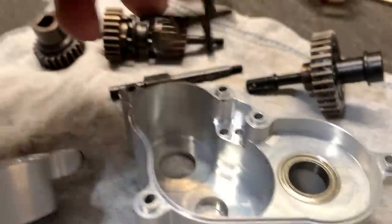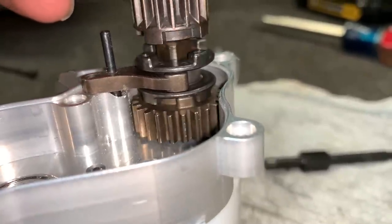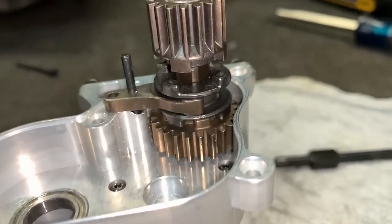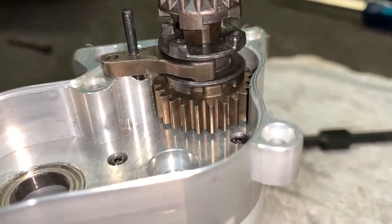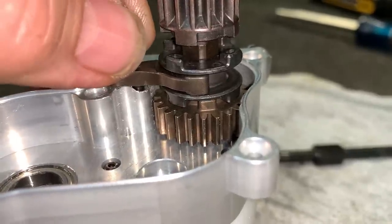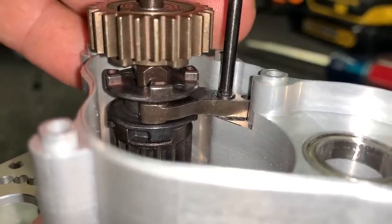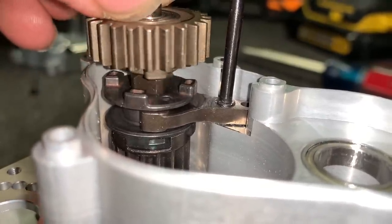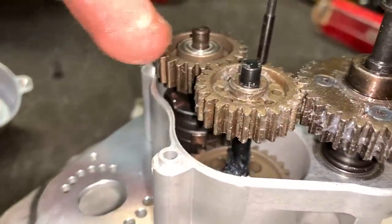This way I can get full lock to both sides. I want you guys to see right here: I have full engagement of second gear — full engagement — and that is all the way down flush to the case. Now, when Arthur made this he made it to the same dimensions as the factory case. You can see there is no indentation, no way for this to engage properly — so this is really an issue on Axial's part. We've got that corrected. This is the low gear right here — I've got full engagement of low gear as well. You've got to maximize that travel.